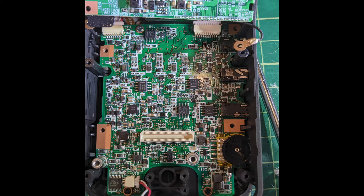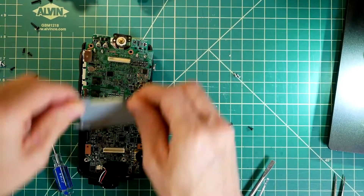Now this is a four-channel chip, so if this device can record six channels, and it's using dual preamps and ADCs, then we expect to see three 5704 chips and six OPA1678 chips for a total of 12 channels. I only see two and five. Oh well. Let's put it back together.